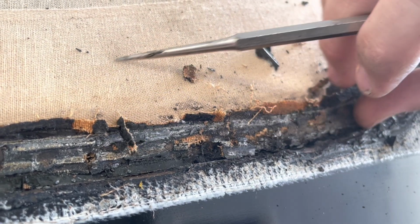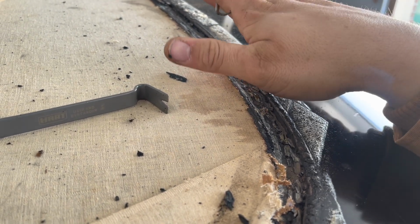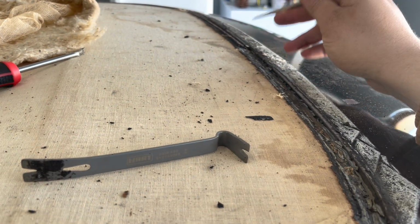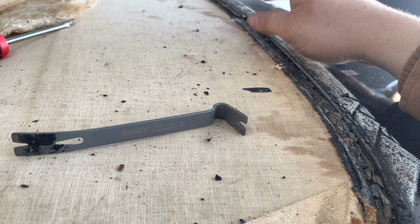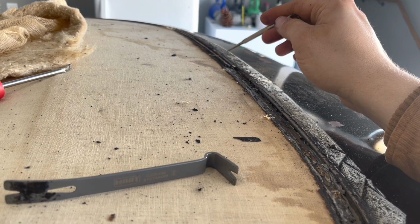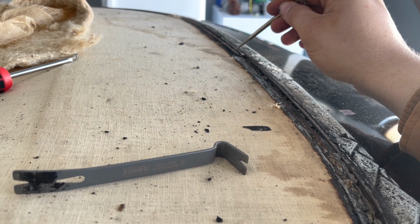a huge amount of sealant here. You can see where it's squished out. Oops. See where it's squished out on the sides, on the roof of the car. They put that metal strip that you see here on there, tacked that into place, and just let it ooze out. Then I'm sure when they pushed it in there and started tacking, they just smoothed it out with their finger on either side. And then they filled the center section that I dug out with sealant. And this was originally painted black, so it didn't matter.